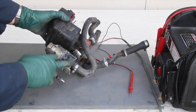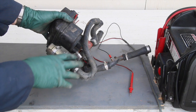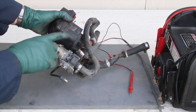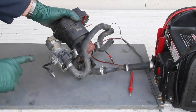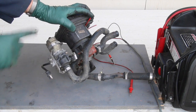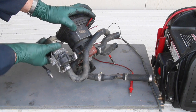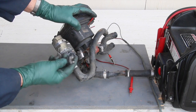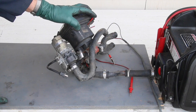This is what the electric auxiliary water pump looks like. It's going to be mounted in different locations on different chassis — generally on the right side of the engine close to the inner fender panel. This one is off a 1979 W123-300D, connected to the original automatic climate control system on those early models. You'll recognize it by this small electric motor. Here's your little pump housing. You're going to have an inlet and an outlet, and they'll all have this two-prong plug that you can unplug, which provides power to the electric motor.